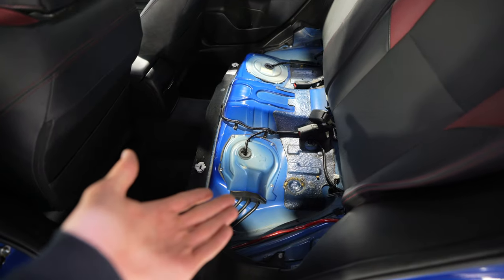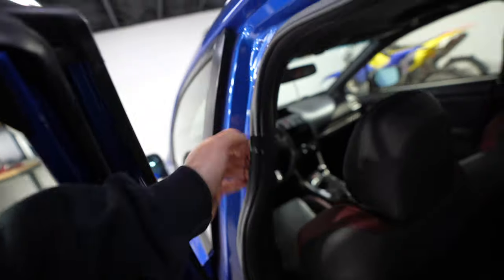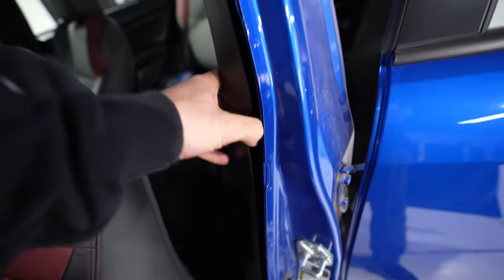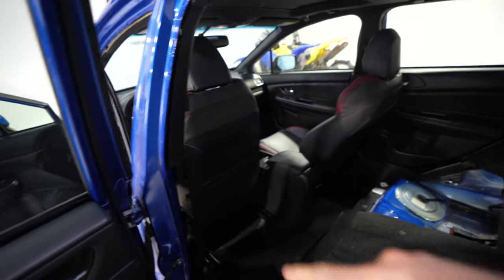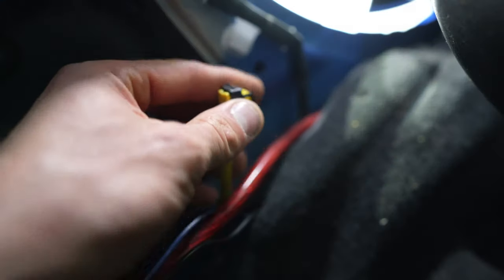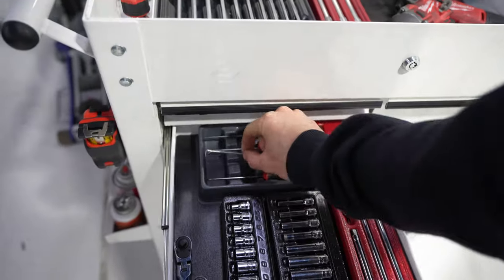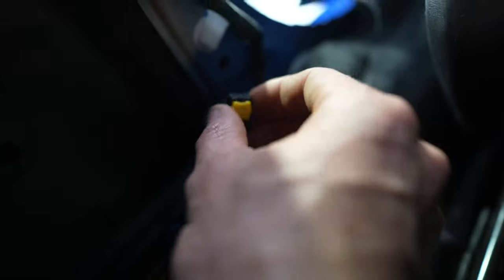If you're asking yourself whether the seatbelts are hard to take out to send to Safety Restore, the answer is no. Once you remove the back seat with the two levers and you remove the plastic trim, you can get to the mounting spots for the seatbelts. You'll need to remove rubber trim and part of the door trim — pull it out in a way so that hook can be free, or you'll break it. That's the same for both sides, and then it's just push pins. There's also an airbag wire; the yellow square is a little release to detach it. Get a little pick, get it behind the square and pull it out just a little bit, then you can pull this out of your seatbelt mechanism. They just pop back in when you reinstall. Took me maybe an hour to get all four out — a couple of different bolts, nothing to stress about.